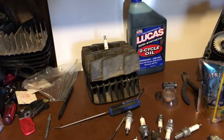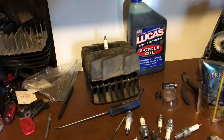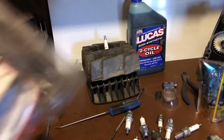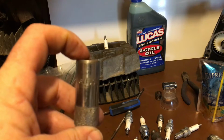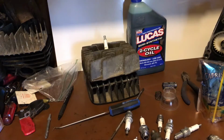It's a pretty cool kit, like I said, and it normally comes with an assortment of different length helicoils. So remember, torque wrench. Use a spark plug socket that has the rubber installed in it. And if you don't have one with the rubber installed in it, don't use it. Spend the money, go buy one. It's going to save you a lot of aggravation.